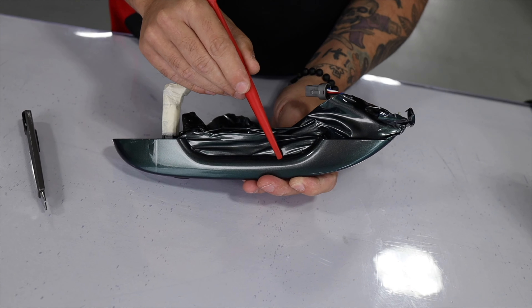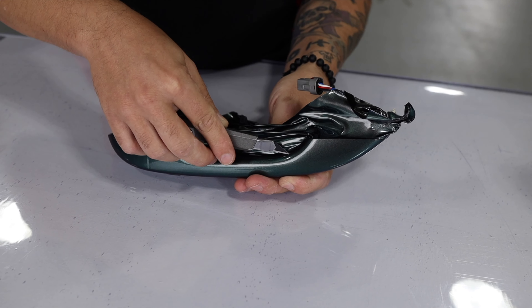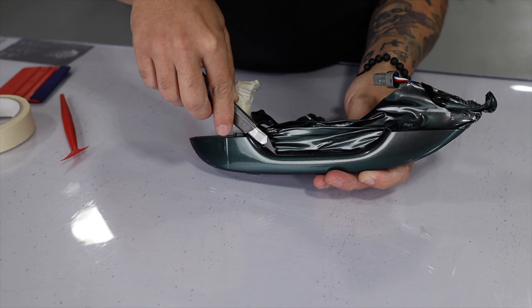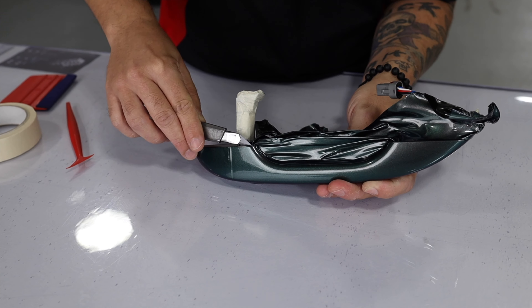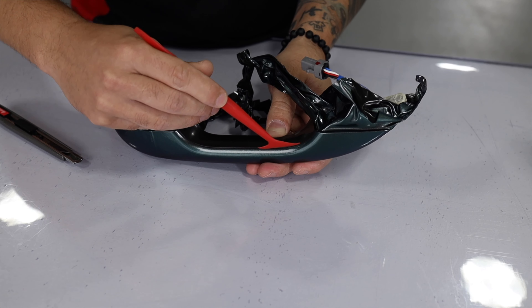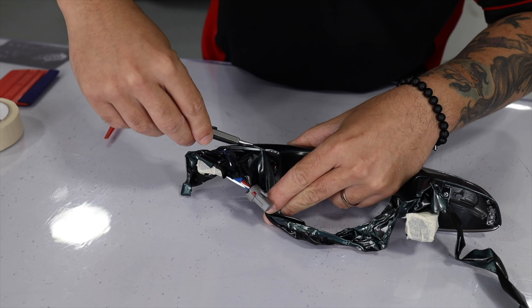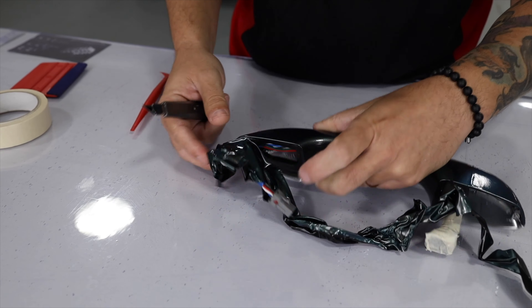Remove the excess film, then for the underside use the back of the tucking tool to tuck it safely into the gap. Cut in the same manner, holding firmly with the free hand, then cut from side to side with the tip of the blade in the gap. Once the cut is made, remove the excess film carefully and then seal the deal. The final cut on the other side is cut flush to the edge and then immediately sealed.